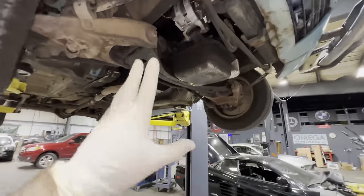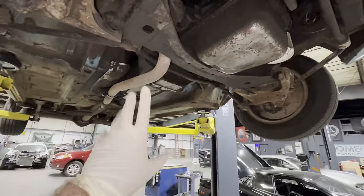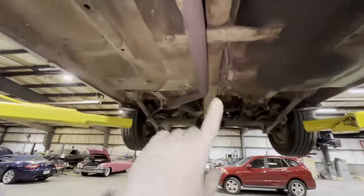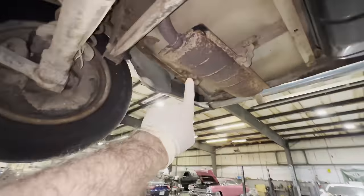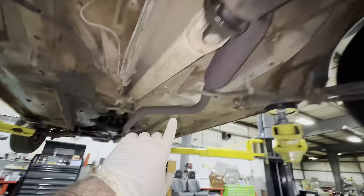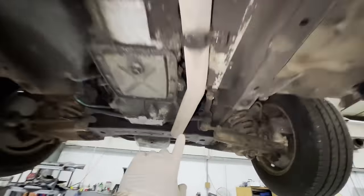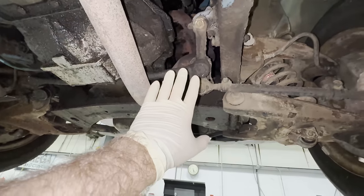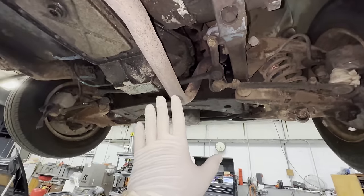I know from Wizard's video you already saw what's wrong with the car, but let me talk about some modifications we need to do. Not much is changing at the back other than fixing the driveshaft. On the exhaust side, we're pretty sure we can't reuse the old exhaust — it's not so much the exhaust itself as the work of welding everything together to keep it cheap. We might have to straight-pipe it, but we're not sure yet.